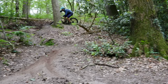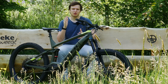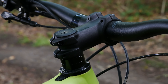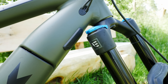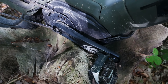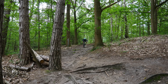How I get on with the Bosch motor is a different story. I personally only really use it in turbo mode, though the e-MTB mode is a lot more forgiving. What I feel the Bosch motors do is kick in really harshly — they don't transition into power assist as smoothly as a Shimano motor does. You just pedal and boom, the motor shoots you up a hill. It's great when you need it but it can feel unnatural, more like riding a motorcycle. Because it's quite aggressive, it's also hard to modulate wheel spin.